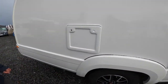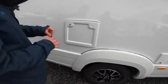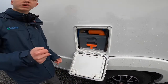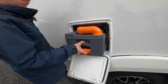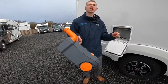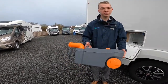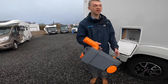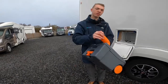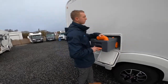There you have your toilet cassette. To operate, you want to close the blade. If the blade's closed, you'll be able to lift the side of the cassette out. Remove the cap. Go to your waste disposal plate, which is normally behind or beside the toilet block. Press the button, tip out. Once you've tipped it out, put some water in, give it a rinse and tip out again. Then use the cap as a liquid measurement — fill with liquid and tip in. If you are using the tablet foam, you put a pint of water in and then drop the tablet down.